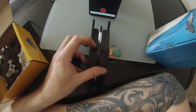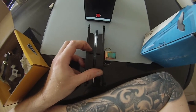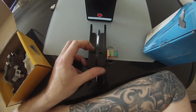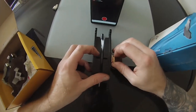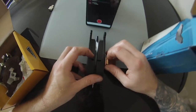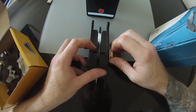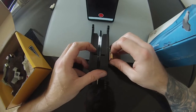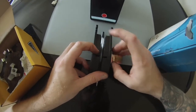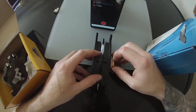You've got the typical standard stock wheel, and you have to take the wheel off. I'm going to say it again, my brake service video shows you most of that. I can't remember now, I did the video a while ago. But yeah, jack the car up, take your wheel off, and have a good look. Steer the steering wheel so the caliper is easy to get to, and have a look at these pads. And like I said, if they're like that crappy one, get them changed.